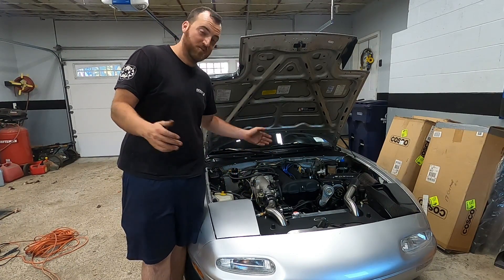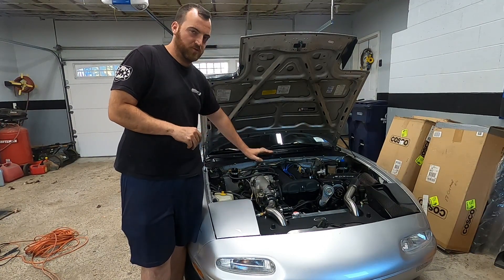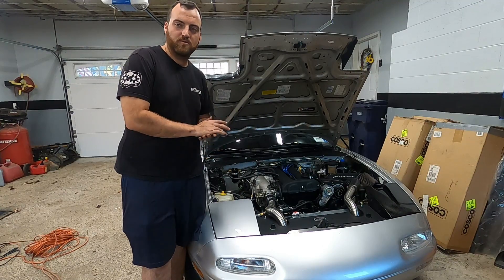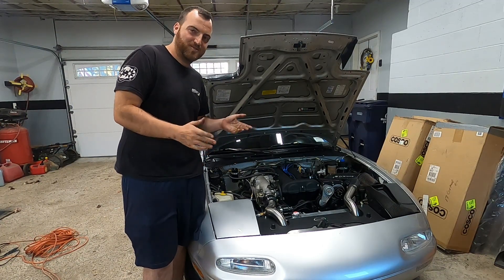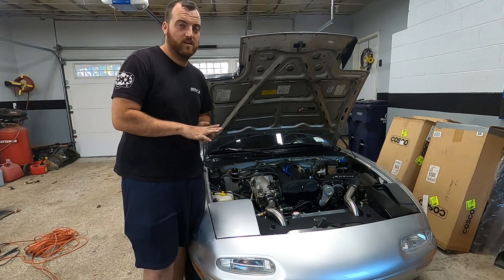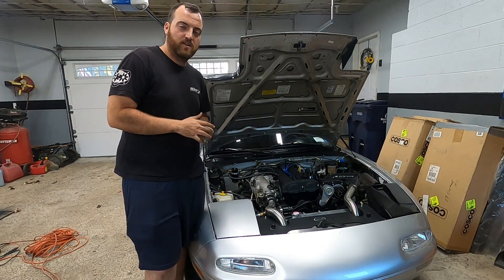There you have it — easy as that, and it looks pretty good in my opinion. I used one can of VHT — actually a little bit less than one can — and one can of primer. So don't go out buying tons of cans. There's probably still half a can left. It's all dry, it's all good, it's ready to run. I RTV'd the corners of the valve cover gasket — I used Honda Bond, which is like concrete — so in a couple hours this will be good to drive, and Joe will be ready to pop his hood at Cars and Coffee. Super easy weekend project, and it really revitalizes the engine bay. If you like this kind of stuff, I've got more planned for Wednesdays — hit that like button, subscribe if you want to see more, and comment your thoughts down below and I will reply to each and every one of you. Thank you, I will see you next Wednesday — have a good one.